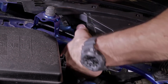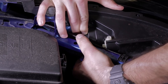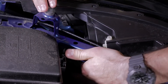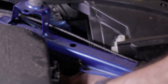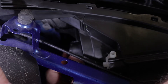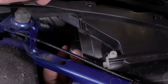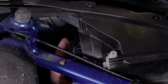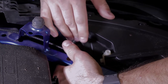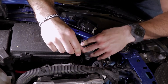Just like on the passenger side, reach down and remove the factory dust cap, then reach in, grab the factory bulb, and pull it out to remove it. Again, tuck the driver inside the headlight housing before seating the bulb. It's worth noting that the SL1 on the driver side of the Cruze does not require any rotation whatsoever. With the SL1 installed, reinstall the factory dust cap and test for function before completely reassembling everything — just to confirm the headlight is functioning properly — then slide the fluid reservoir back into place. Your installation is complete.